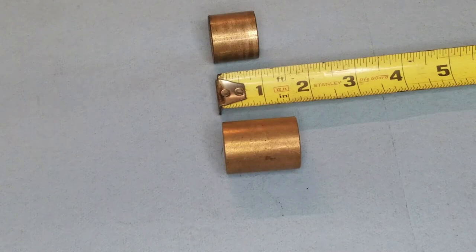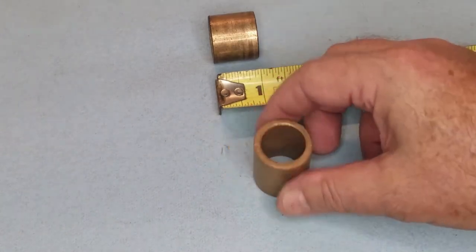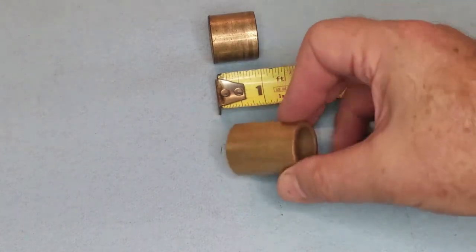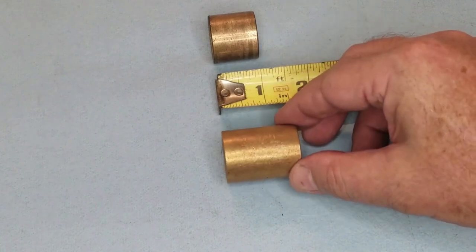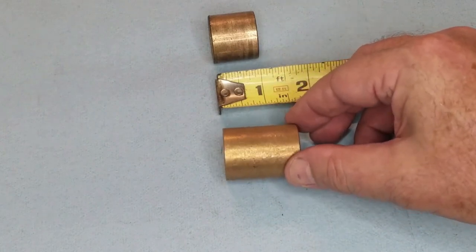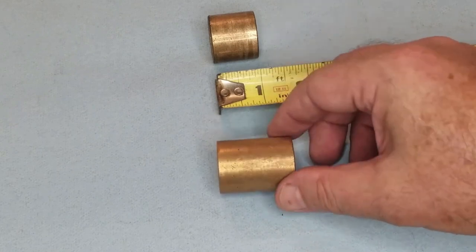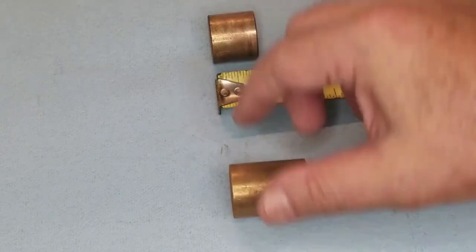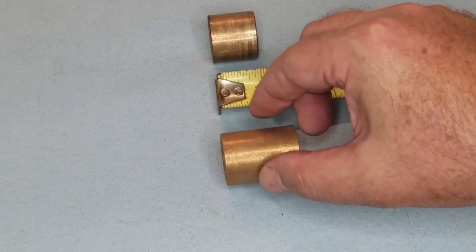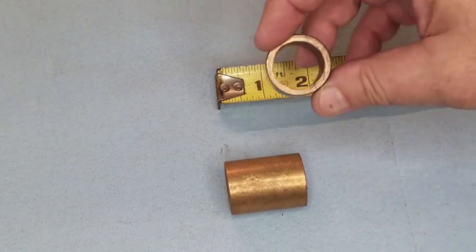It is quite often the case there's a lot of variation in parts. I ordered a spigot bearing, most people call it a pilot bearing, and it was in the description. It said 18V and 18GB engine, and so I'm like, okay, I got the right one, but no, actually not. This is the one that came out of the car, and you can see that's significantly smaller. I'm obviously not going to put it back in. It's a little bit banged up, no better for wear.